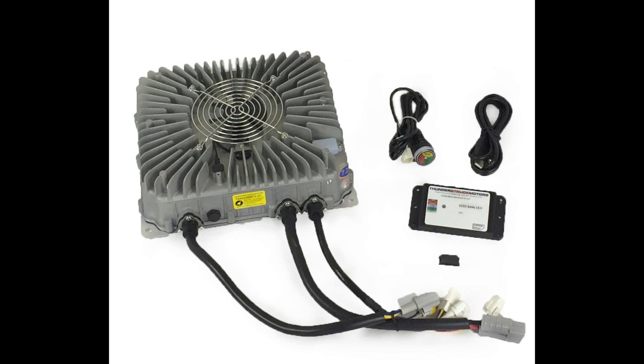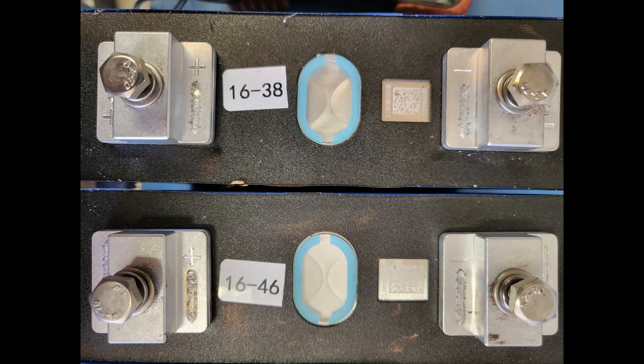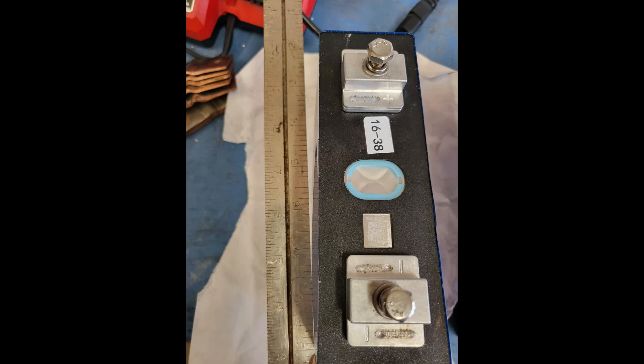At this point, I get the Bikmoto back to my shop, open the pack up again, and oddly enough, I find that the voltage on two cells is completely drained down to zero volts. The BMS doesn't even register those cells — it counts them as missing. I pull those two cells out and I can't seem to get them to hold a charge. They won't even charge up to 3.4 volts, and as soon as I take the charger off, the voltage quickly falls on its own just sitting there idle. And it's after attempting to charge these cells that I notice they're terribly bloated.